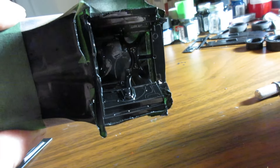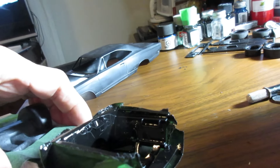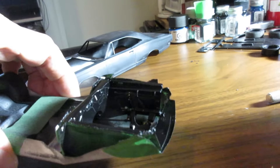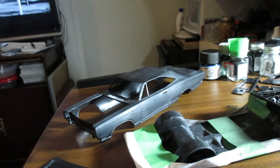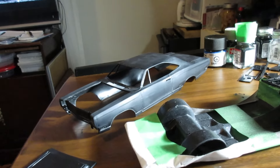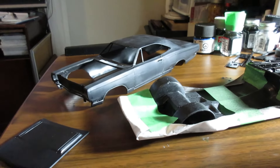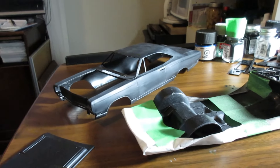There is a bit of gray showing — it could use a third shot, but not on the engine bay. I'm going to give the executive decision here just to go for it the way it is, let things dry off. However, the body will probably need three coats, I'm going to guess. We'll see how that turns out. But not today — today is just primer. Let's get that outside and get that ready to go.